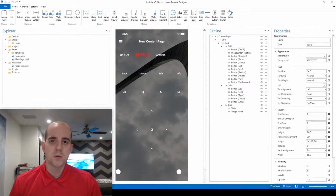Now, using the regular receiver remote, we can only make small volume adjustments by either clicking the volume up or down or maybe holding them down to repetitively fire that same IR command. If you walk over to the receiver, you can manually adjust the volume by turning that big knob on it. I want to have that same fast volume adjustment capability utilizing the home remote, and to do that I'm going to use the slider control that we placed down at the bottom previously. But first we've got some legwork to do.